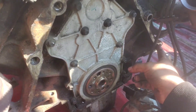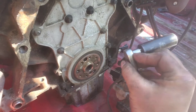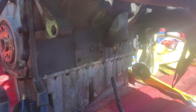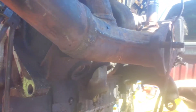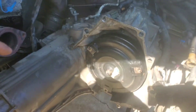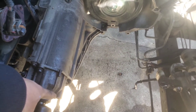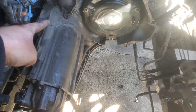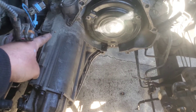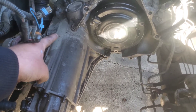This one is tricky. I used a quarter-inch ratchet with a couple of extensions to get it — it goes from the inside right below the manifold. You can see the manifold right under the bolt I'm talking about, it's in that corner right there. You have to get in between — go down at the bottom right here and use an extension to get up. I used a mirror and about three extensions to get in there with a quarter-inch ratchet with a quarter-inch to three-eighths adapter. That's the way I was able to get it out.